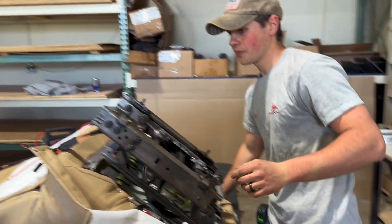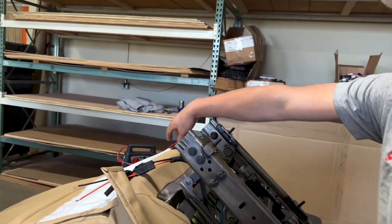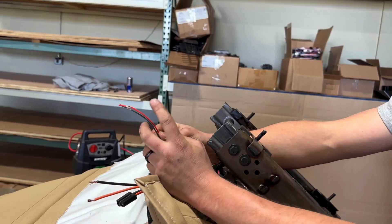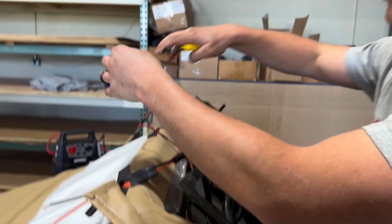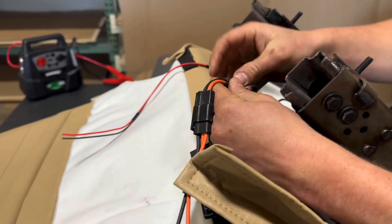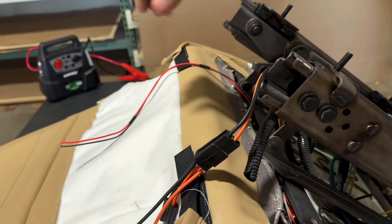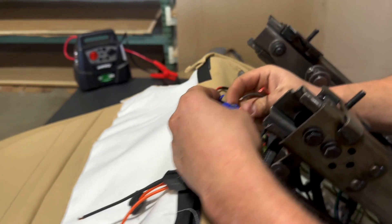That's tight. We've got our main 12-volt here. Now we want to tap in the power lumbar, footrest, heat, or whatever other options you've got. I've got a red and black wire here — you can tap them in however you want. We use scotch locks, these little guys — they're real nice if you can find them. Wherever you want to tap them in, just pull some of the plastic back or tape, and I'm going to scotch lock these in real quick.